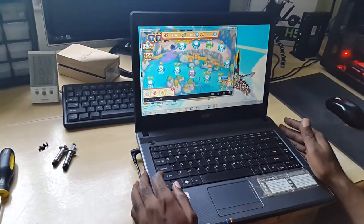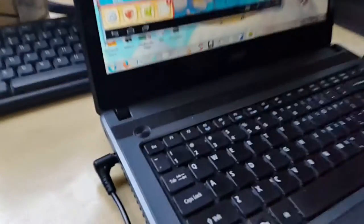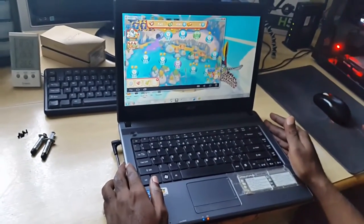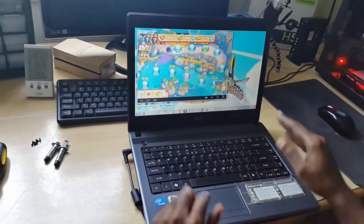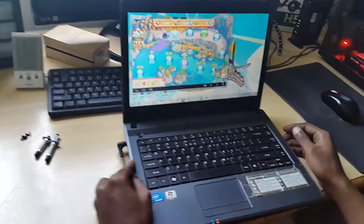Let's start with how you know your laptop is overheating. Do you hear that high-pitched sound? That's usually a clear indication that your laptop is overheating. What's happening is that as soon as your laptop starts to do anything graphically intensive, you'll notice that the fans will ramp up and you'll get that wind-up sound.